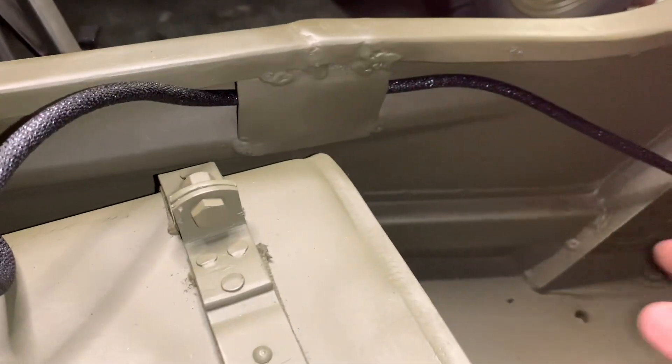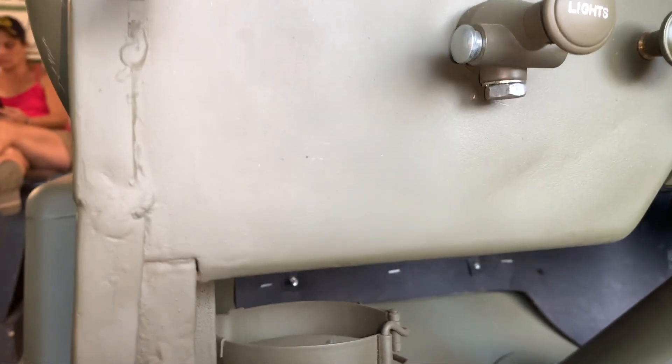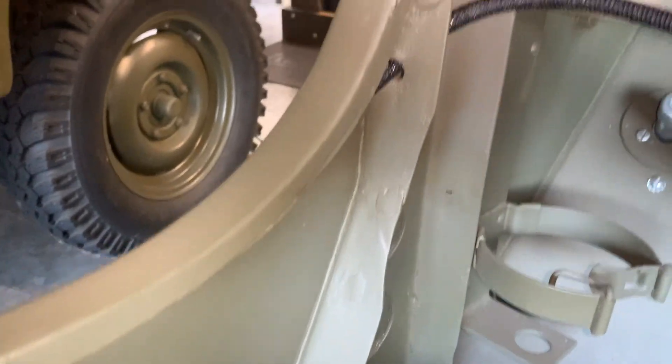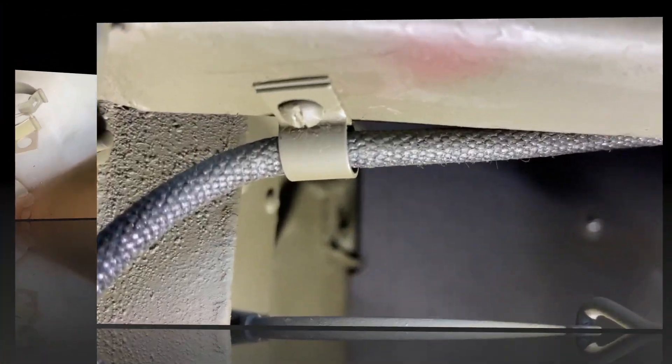We want to keep everything straight with no loops or kinks in that wire. Just keep feeding it through — you want a little bit of slack but you don't want to pull it tight. The next location we're heading to is the dash itself, and there's going to be a little hole drilled right on the lip or curvature of the dashboard with a clip there. We'll feed it through the hole in the gusset, go up inside that gusset, and head right for that hole with the clip. Before we do that, take up any last bit of slack and tuck it underneath the lip — you just want a nice little bit of slack in there. The clip is installed with the loop facing away from you, then take that end and put it up underneath the back side of the cowl.